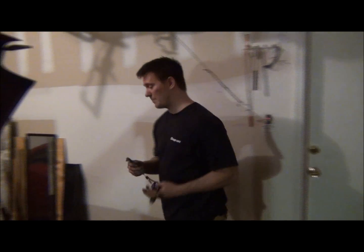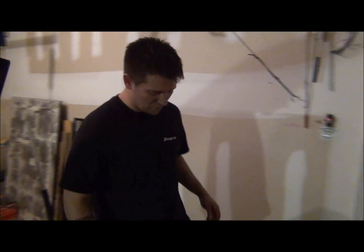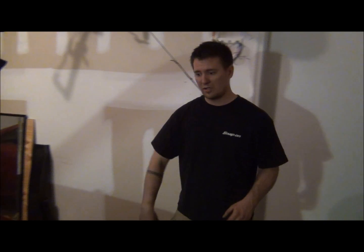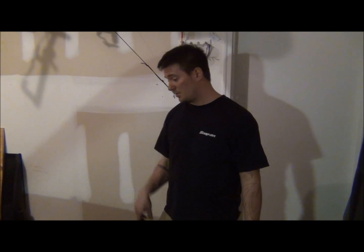It's located under the balancing shaft belt, behind the crank pulley and all that. So we're going to go in there and replace that today. I've already got it started here. We've got the car jacked up in the front with jack stands under it. We've got the front wheel off, and I've already broken loose the crank pulley.